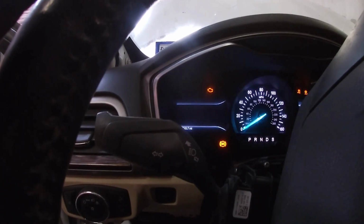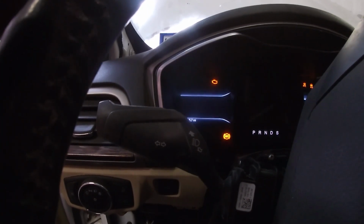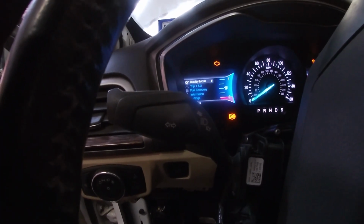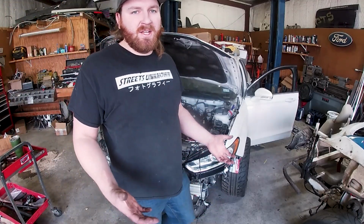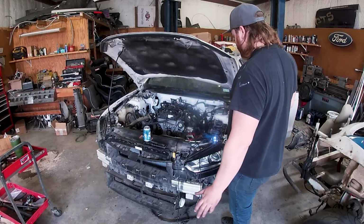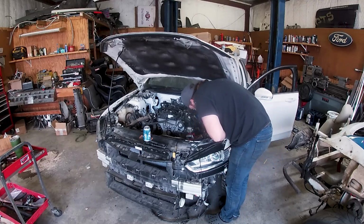I don't hear any fuel. Let's see if it cranks. Still hear the relay. No cranking. That's lame. Well, I can try to jump everything and see if it starts. Okay, well, the fuel pump's turning on if I turn the key on after a while, or I put the key in. So, let's see if it runs if I bypass the starter.